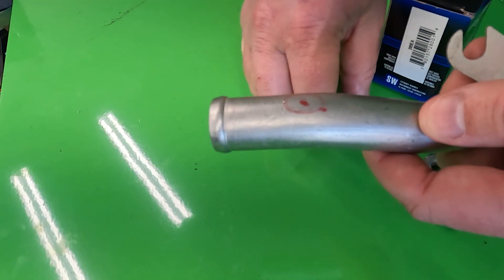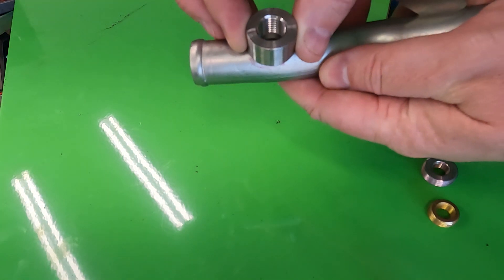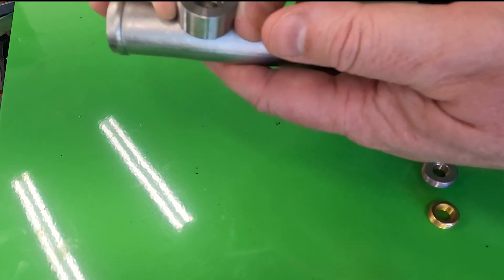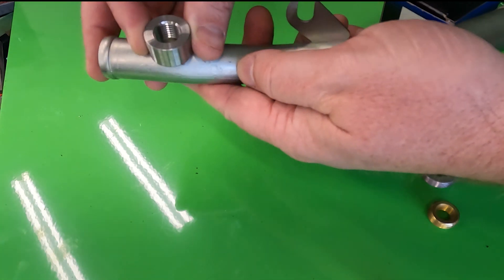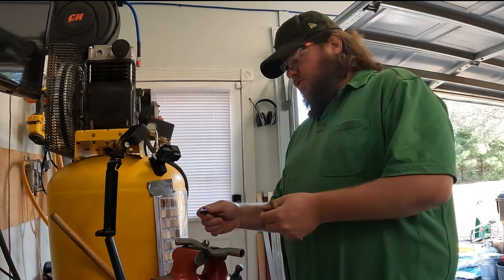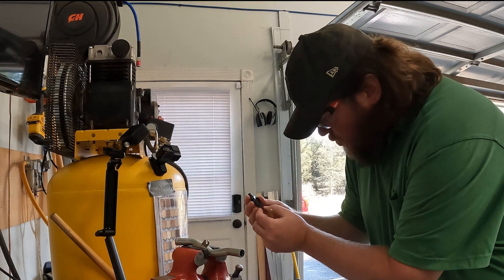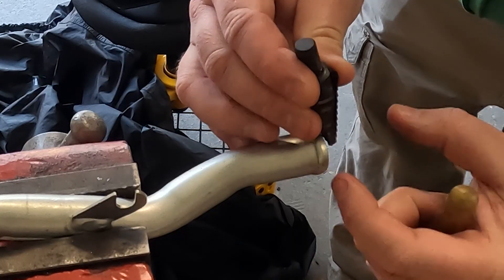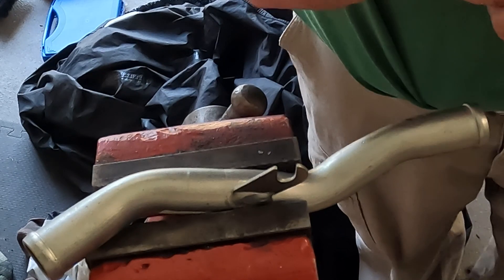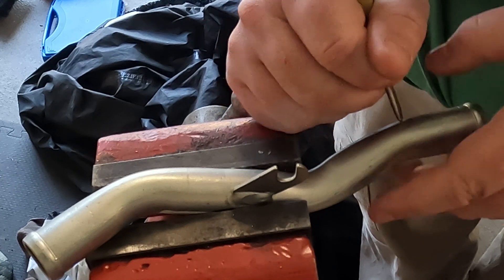I've already marked this up a little bit. I'm probably going to move it down just a touch. If you notice, this is kind of parallel to the transaxle right there, so we want this faced off just a touch over. To drill this we're going to go ahead and use a step bit. I did measure and I want a three-eighths-inch hole, which goes down to this line here — and as you can see, we're good to not go all the way through. We'll put a dimple in for a starting point.